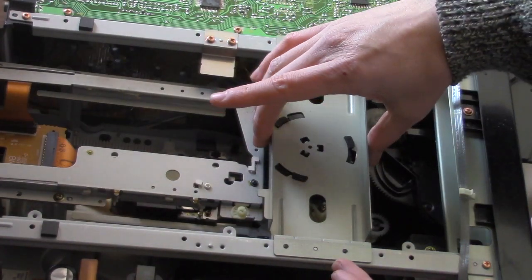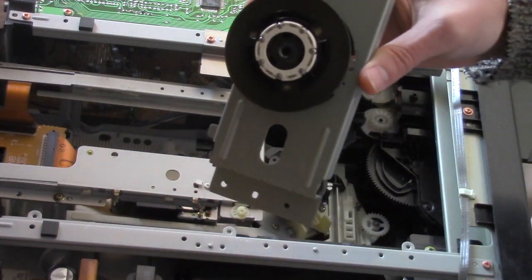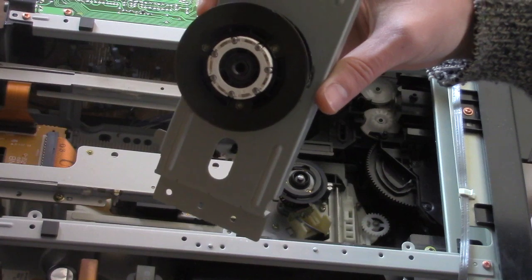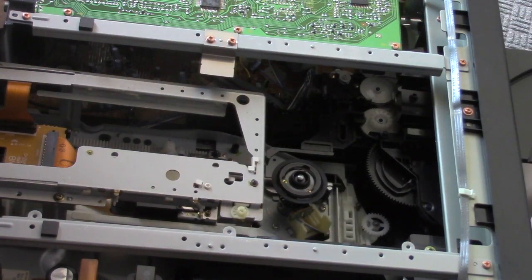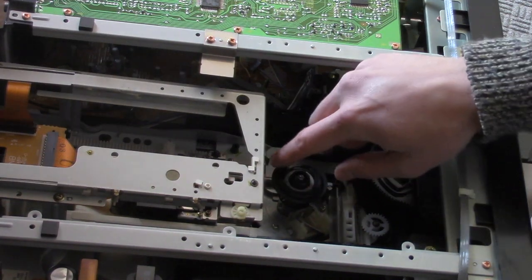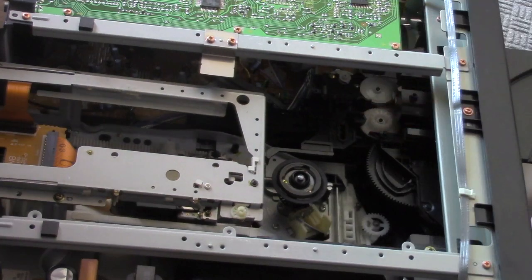It's been safe to kind of stop it manually before it drops back down. So let's take a look. I've already unscrewed the top part of the clamp here. I had cleaned that at some point the past few days — it helped a lot, but it wasn't the ultimate cause. The ultimate cause of our problem here is that little grip ring that everyone has had issues with, especially on these later players.